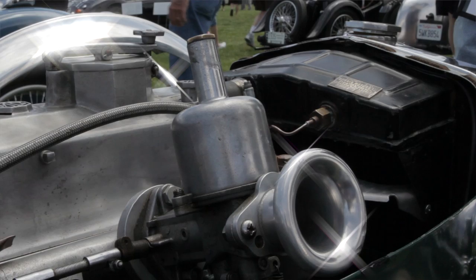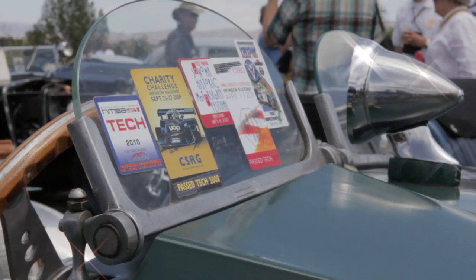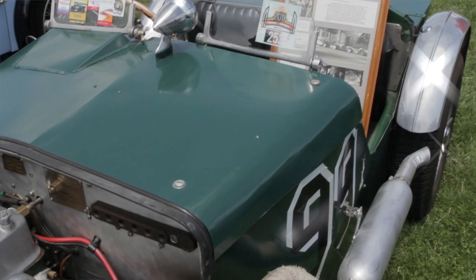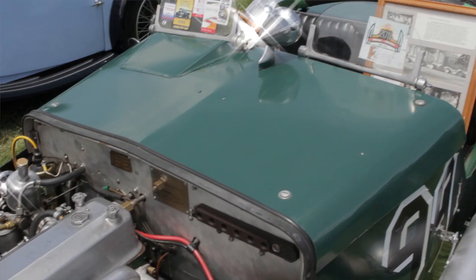It's 1,428cc, approximately. Do you know what kind of horsepower it makes? We estimate it at about 80 horsepower right now. Originally, when they came from the factory, I believe they were about 56 horsepower. So this one is a little upgraded — we replaced the pistons and the rods, so it puts out a little more than it did stock.